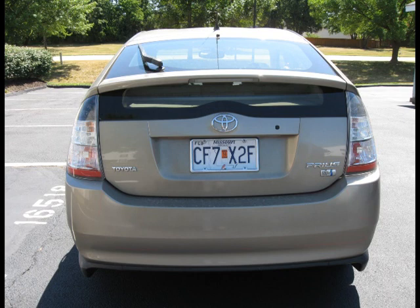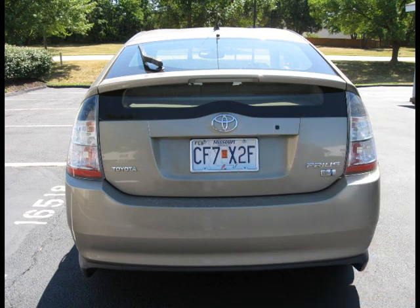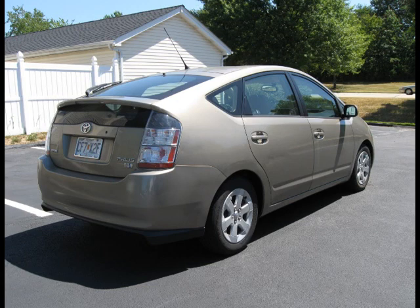If you painted the area behind the license plate and find out that your license plate holds on only on 2 screws instead of 4, then it may cause your license plate to bang on your newly painted area while you drive. In order to prevent that, you may apply some self-adhesive foam weather seal on the reverse side of your license plate to prevent it from banging on the newly painted area and possibly causing some damage. The foam weather seal could be found in any hardware store.